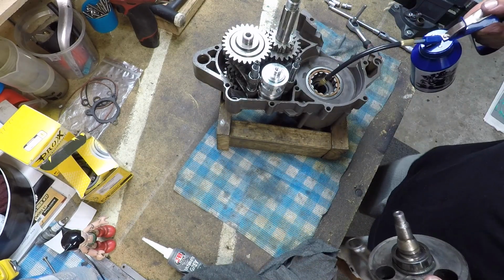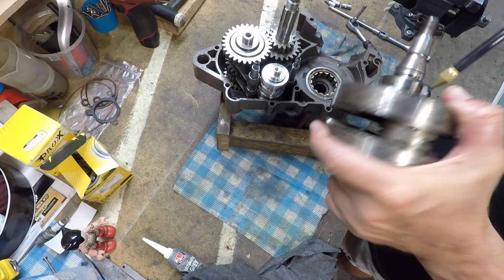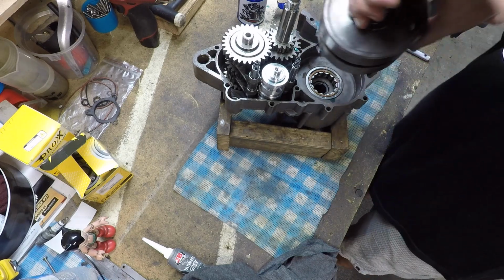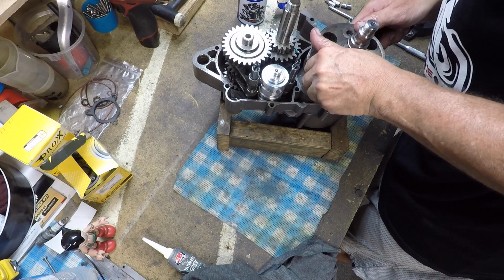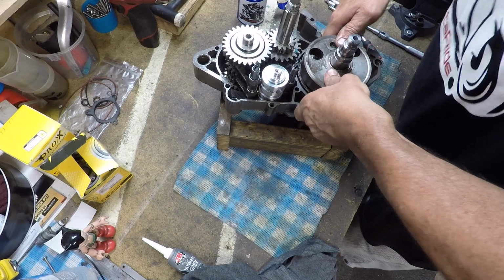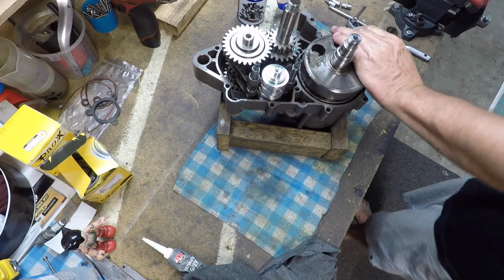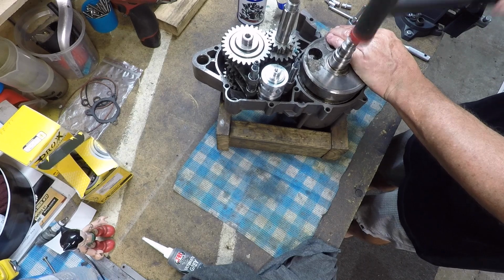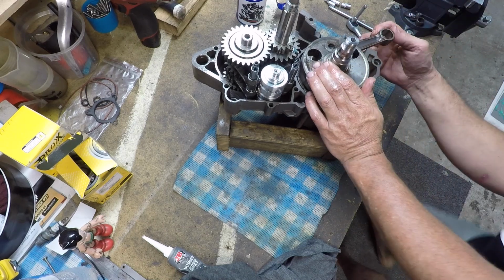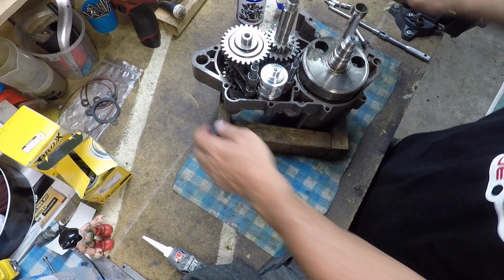So this is just two-stroke engine oil that I'm using just to do a bit of pre-lubing here. Just don't want any dry metal running against dry metal, if only for a moment before the oil does its job with the oil pump and whatnot. Oh yeah, straight in. Hear that note change on the last maybe 3 or 4? That con rod sitting even. Oh yeah, that's a new bearing. Get some of that in ya. Okay.